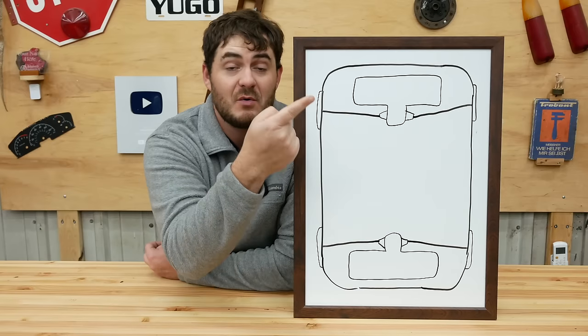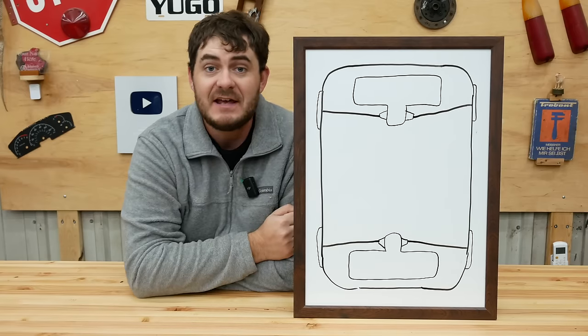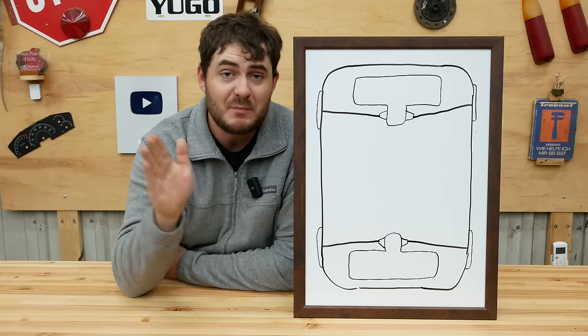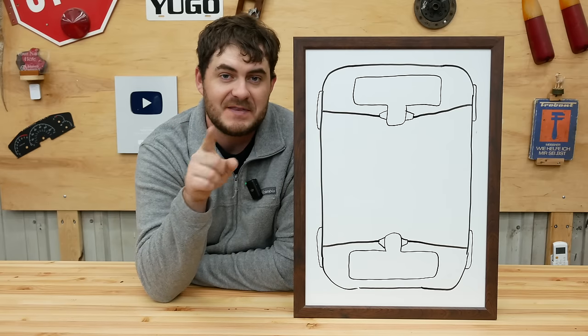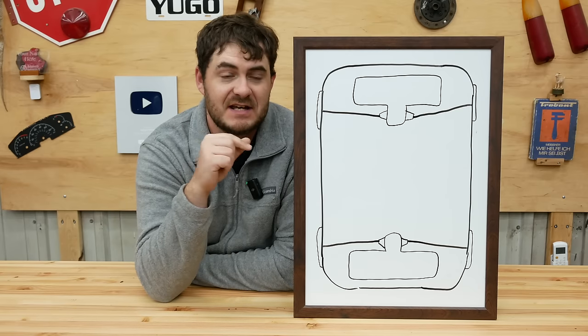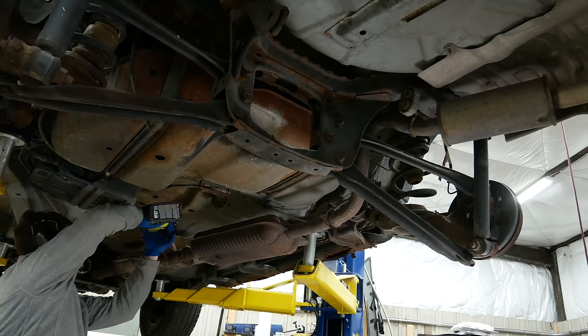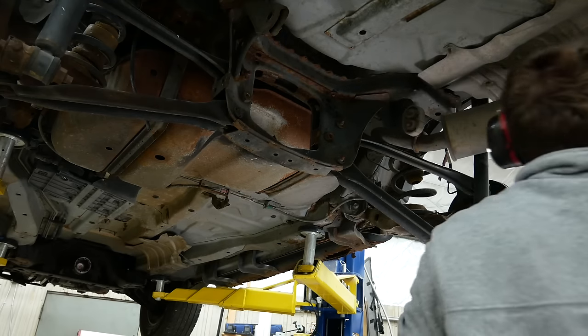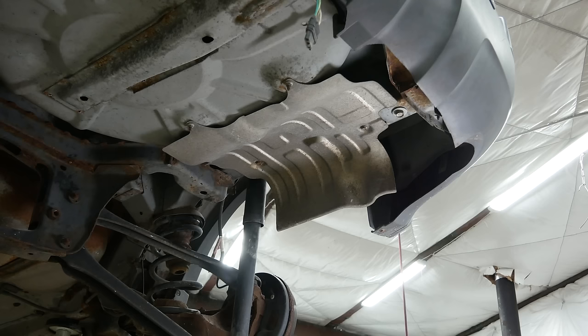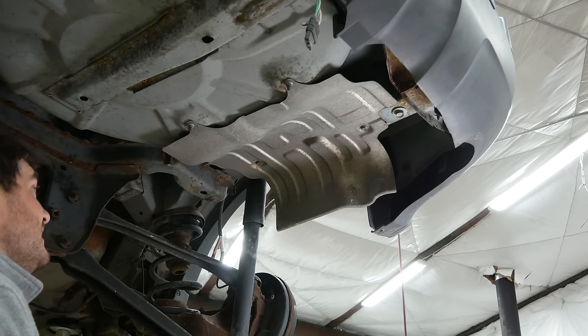If I do choose to orient it in front of the front axle, it'll be running in reverse, which is no problem because it's an electric motor. Although I think there is a unidirectional oil pump in the gearbox I'll have to change out if I do decide to run it in reverse. Heat shielding. Where we're going, we don't need heat shielding.